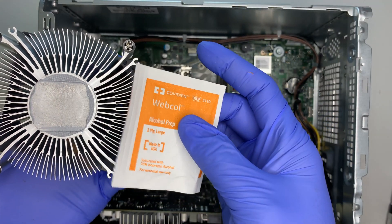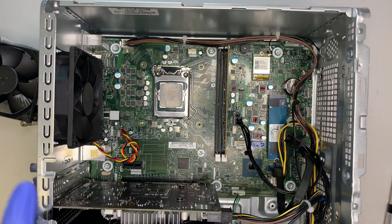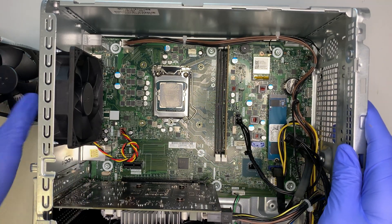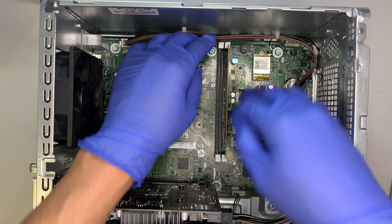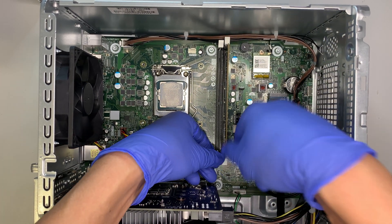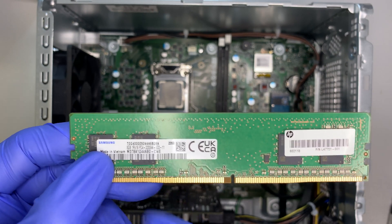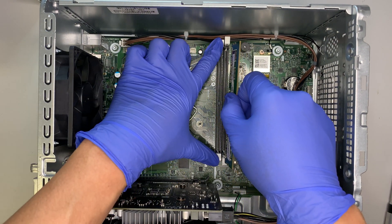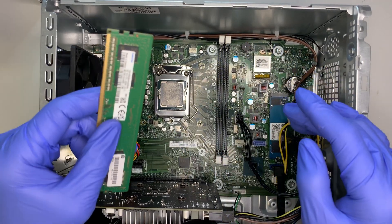Get alcohol wipes, wipe it down, and also wipe down your CPU. Once the thermal paste is fully cleaned off, apply a little bit of fresh thermal paste on the CPU for better cooling afterwards. Now let's move down — this is your RAM, which is DDR4. To remove the RAM, push the two side clips up and the RAM releases. As you can see, PC4 stands for DDR4 and this is an 8GB stick. You can install in slot one, and a second stick in slot two for 16GB total, or go 16GB plus 16GB for 32GB of RAM.